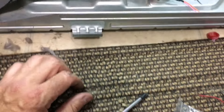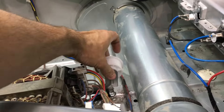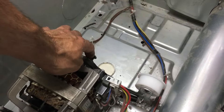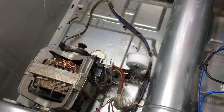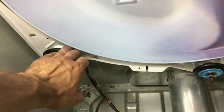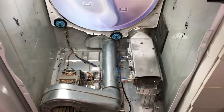With that, we're done with the install of materials. Now we've got to put the drum on and reattach the belt. The belt comes down off the drum and around the tensioner pulley, then across the motor — it's actually a serpentine belt with little grooves that the motor engages with — so the back of the belt runs around the drum on the smooth part, and the grooved part goes around the motor and back up around the drum again. I'll re-vacuum first because there are a lot of nooks and crannies. Remember you've got to pop the edge of the drum over these wheels when putting it in.